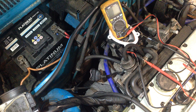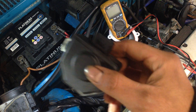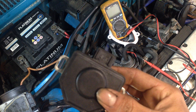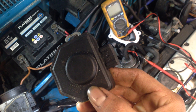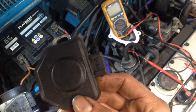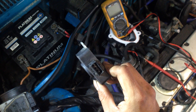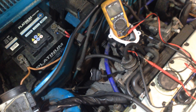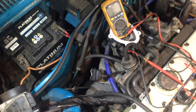The pins we've pinned out — I've got them here, the pins are labeled 3, 18, and 2. Now 18 and 2 are the uppermost ones; with it bolted to the engine, those are the top two you need to connect. Set the multimeter to ohms.